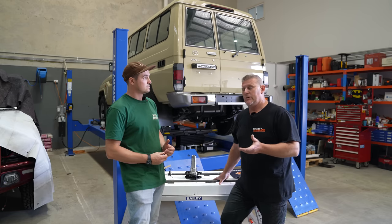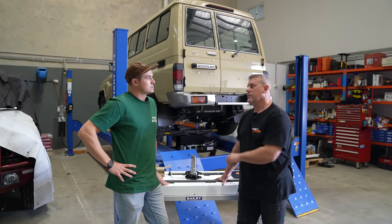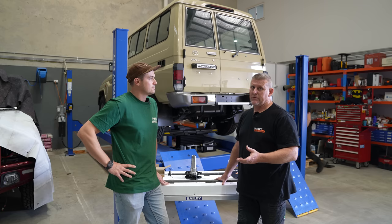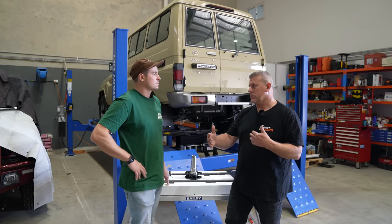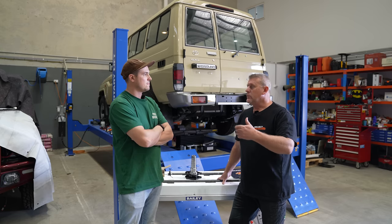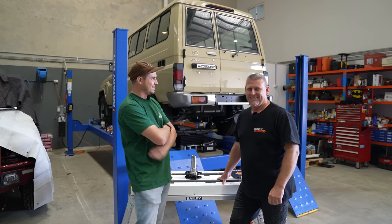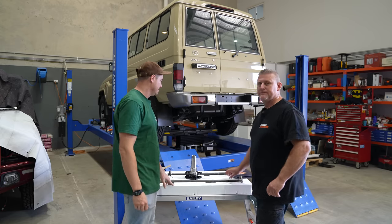The only thing just to touch on is the 76 Series is the only one that doesn't have a bolt-on track correction — they've got a different diff, a lighter diff, it's not a laminated diff. But MultiDrive still have a kit, a system for the 76. And I reckon the 76 is one of the ones that's going to benefit the most because of the short wheelbase — you'll feel it a lot more. So they do have a full diff replacement in their system. That side's just been finished now, just putting the wheel back on. Very exciting.